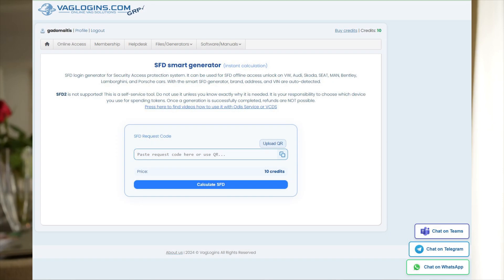I had changed the 12V battery but hadn't registered it, and that might be why it wasn't starting. I found a webpage where I could generate an SFD code myself and activate the programming mode for the gateway. I did the battery calibration, but it didn't help. I talked to ChatGPT and he said I must reset the gateway so it would adopt the changes — I did that too, and it still didn't help.